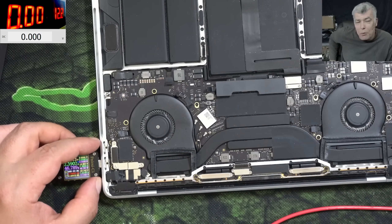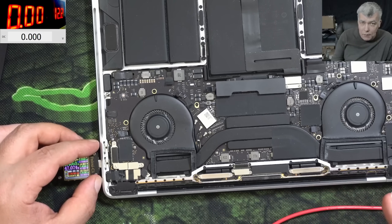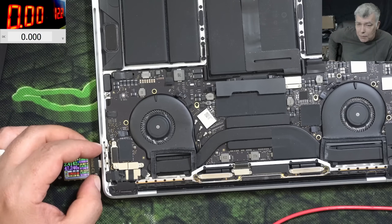What did we do wrong? Probably nothing! You have 10 ohms on the main power rail — how will you find where the problem is? You have to remove each component from the main power rail, and there are hundreds of components on the main power rail. So that cannot be taken into consideration.